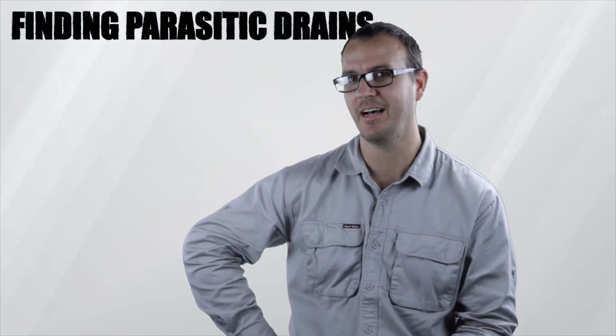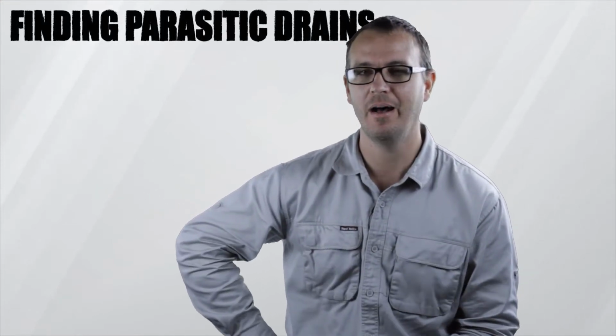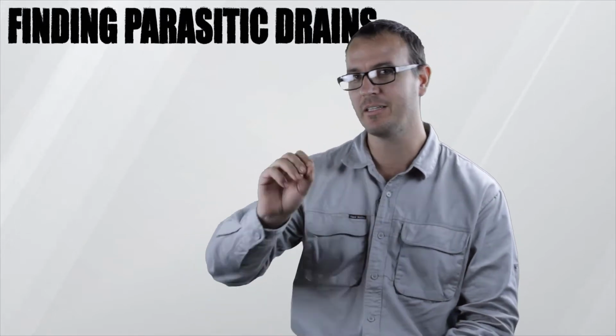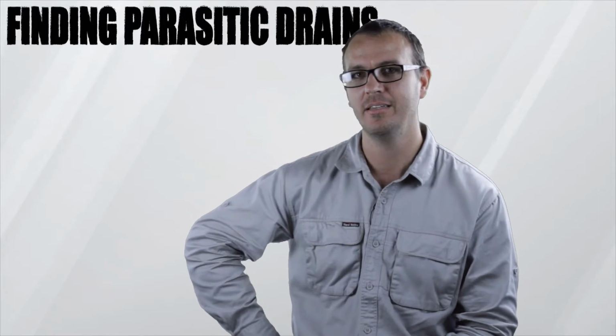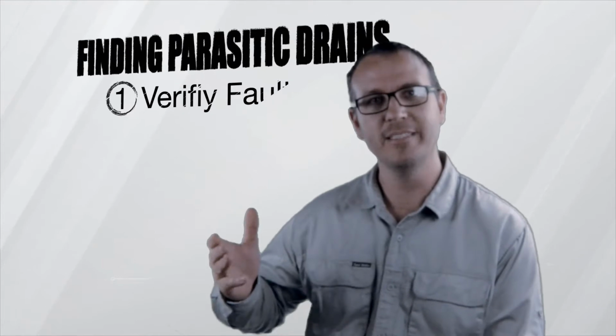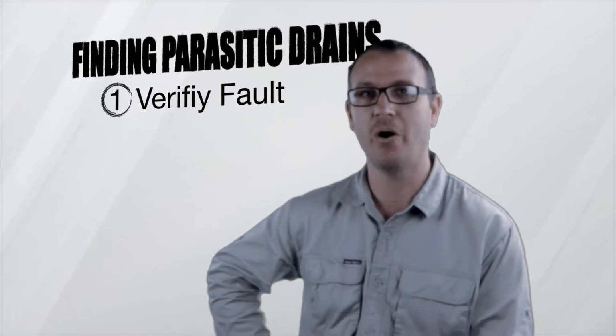Parasitic drains suck. Customer complaints like, my battery goes flat after a couple of days can be a bit troublesome. So there's a couple of quick steps to make finding parasitic drains a little less painful. As always, the first thing that you want to do is confirm the fault.